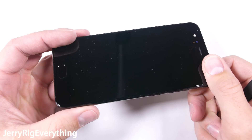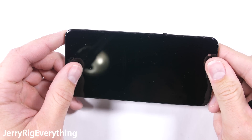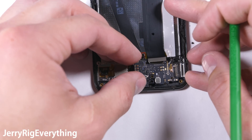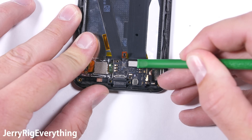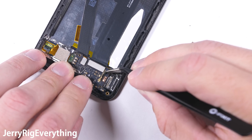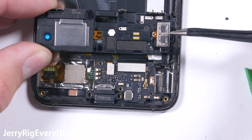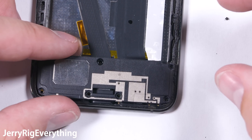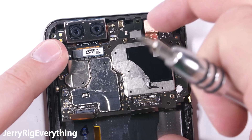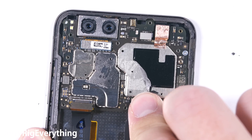Now for the display. It's glued into the frame of the phone and has to be removed with heat just like we did with the back panel. I'll put links in the video description as the replacement parts become available. And now it's time to reassemble this thing and see what it looks like clear. The charging port gets set back into place along with the extension ribbon and the fingerprint scanner ribbon — they'll snap in like little Legos. And then the round wire cable gets clipped in as well. One screw holds the whole board in place. This plastic holds both the loudspeaker and the vibrator, so we need both halves. The top motherboard has one screw holding it in place along with the volume Lego connector, the extension ribbon, and the screen ribbon cable.